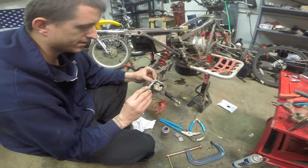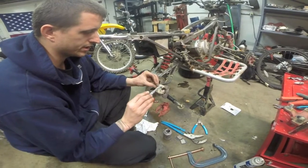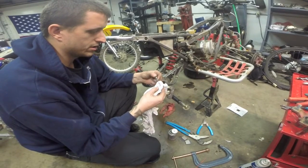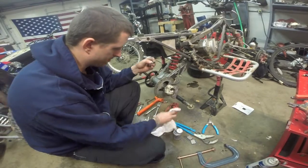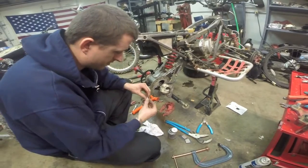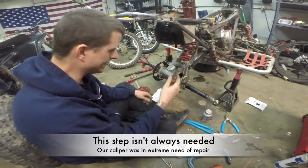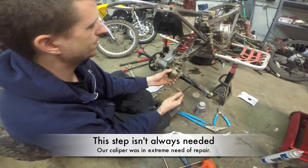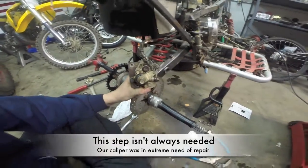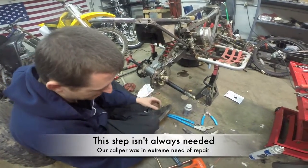Just take a little bit of anti-seize and give them a real light coat. You don't have to go crazy — just pretty much to make sure the pad doesn't seize to the pin. Just dab all the excess so we don't have a ton on there, then set it off to the side and do the same thing with the other one. One tool we forgot in the beginning: a 6mm Allen wrench. We forgot about the one slider bolt — as you can see right here, it's removable. So we actually loosen that up and you're able to pivot the mounting plate with your sliders pinned out of the way.